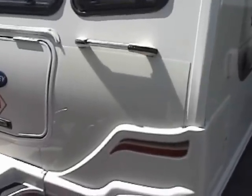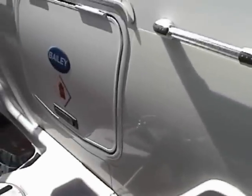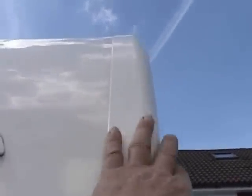Here are some of the mods I've done to the outside of the caravan to stop water from possibly getting inside the lockers. As the water runs off the roof, it can't go sideways due to this molding here — it has to run down the front. When it gets to the stone guards, the easiest way for it is to go down and find its way into the locker, similar to the gas locker.